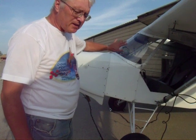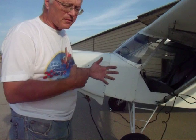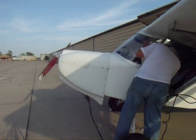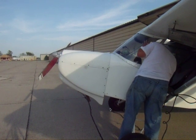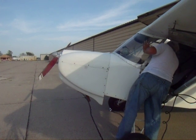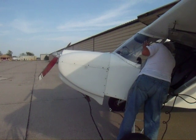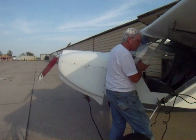I'll turn things on in the cockpit. You've got to check on this 912 - it's got a spring-loaded throttle that opens it up all by itself, and that's not good. So we'll make sure the friction lock is tight so it stays closed. Okay, throttle's closed, choke is on, fuel is on, mags are on. Throttle's closed and tight. Fuel's on, mags are on - it should be hot. We'll see what happens.